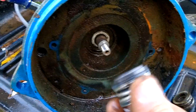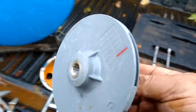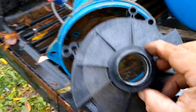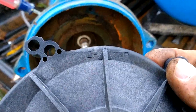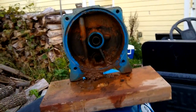Make sure the seal goes in like that. Then you're going to thread on your new impeller — thread that on there. Put the cover back on it. Make sure on these there's a correct orientation — this side's up right there, so that goes facing up towards the top, just like this. Then put it all back together after it's all cleaned up.